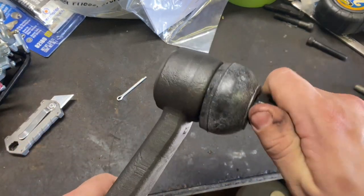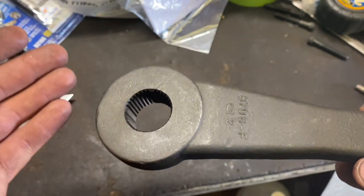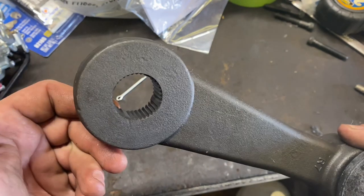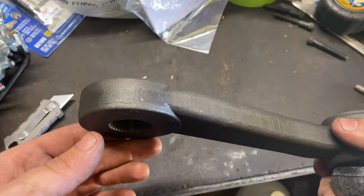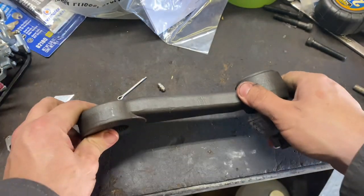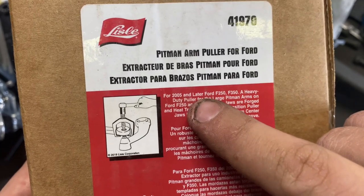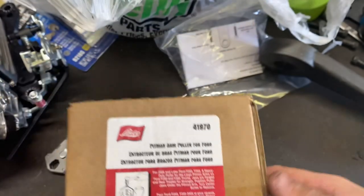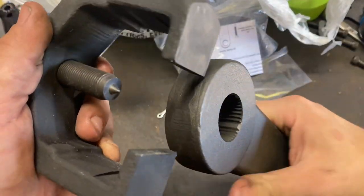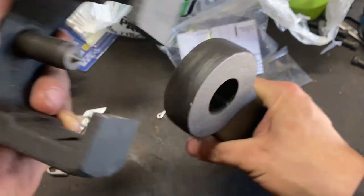This right here is nice and tight — we can take that sloppiness out. All we've got to do is remove the old one and put this one in. Be mindful that this is two and three-quarters across here, so make sure you've got a pitman arm puller big enough, otherwise you won't be able to remove it — they're a press fit. The one I had was too small because this is the first four-wheel drive I've ever done. I had to go to O'Reilly's; they didn't even have one, had to order one, and I picked out which one would fit and bought it. The puller I got says it's for 2005 and later Ford F-250/350, but this is the one that fits this F-150 4x4 pitman arm. It just slips over like that — perfect — and it'll pull it right on off.